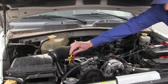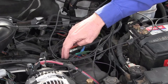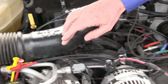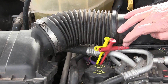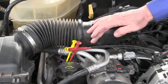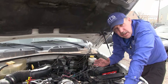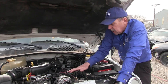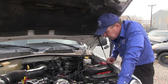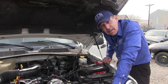I've connected the crank sensor to channel one, the cam sensor to channel two. Channel three is on the ignition coil for cylinder one, four is connected to the injector for cylinder one, five is connected to the coil on number two, and six is connected to the injector for number two. Channel seven and eight are connected to the injectors. While connecting this I can see they've been working on it — there's a new alternator and a new control unit. They've definitely put some parts on this vehicle trying to fix the stalling issue.